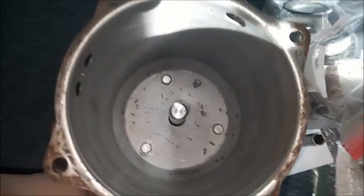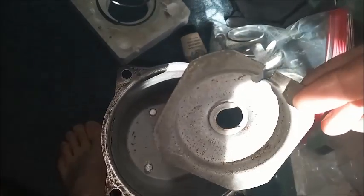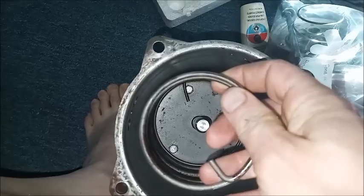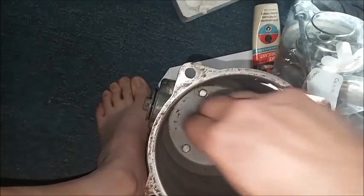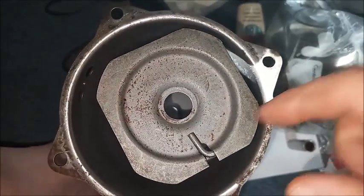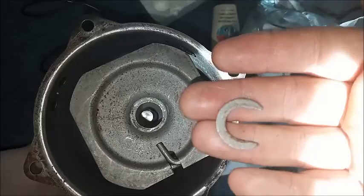Next thing for Bendix is to put the spring in, here's the spring, with its retaining plate and C-clamp or C whatever retainer. I can see a mark down there from basically where the spring was sitting before, so I'll set it like that. So it's just a matter of pressing it down, putting the hole in the center of the retainer far down enough so that the C can be slid into the groove here in the plunger. I have a spring in there and this hook at the end over the plate, and it's just push it down and retain it with the seat.